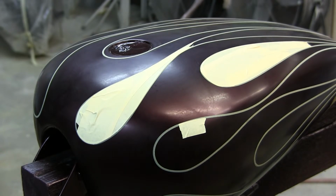It really makes the pearls stand out. It's just like if you're using a chameleon or anything else, you want to put it over a black base coat. You don't have to. This is a base coat, so with enough coats you can completely cover anything. But with black, of course, you would use fewer coats, which would save you money. It's an SG100 base paint, I believe, so you don't want to get too thick, because then you get shrinkage. No one likes shrinkage.